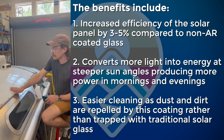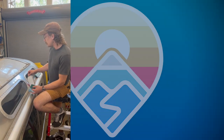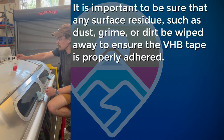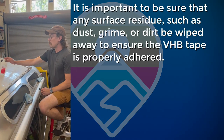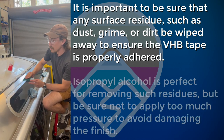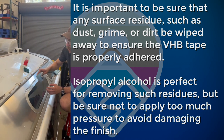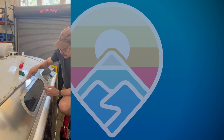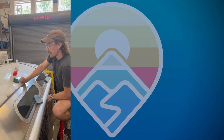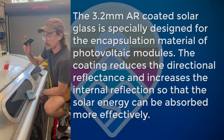Some areas need more cleaning than others. I've already prepped the areas where the feet are going to go, but I'm going to go over it one more time with a little isopropyl alcohol and very lightly use the scrub brush to get rid of any surface residue, then wipe it away. That's so our VHB tape sticks perfectly to the roof — not to dust. You don't want to go too hard because it will strip the paint.